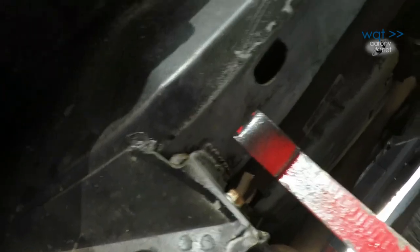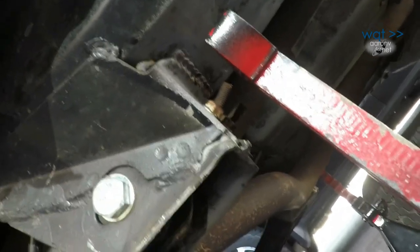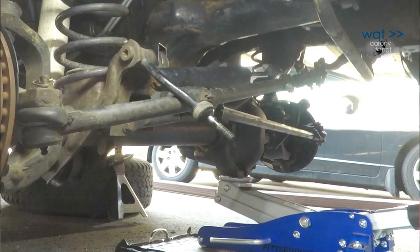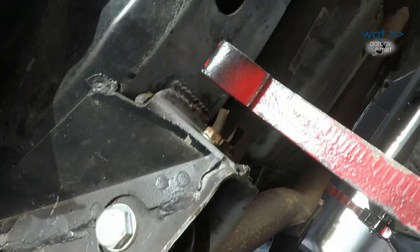Wow. Look at what happened there. The jack stand, instead of coming up under the frame rail, started to come up under these bolts. And as a result, they started to bend, then it popped out and dropped the jack stand. So thankfully, I wasn't in a hurry, or I would have dropped this whole side of the vehicle down on the tire.